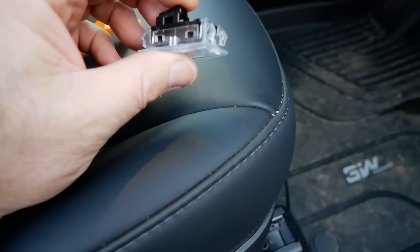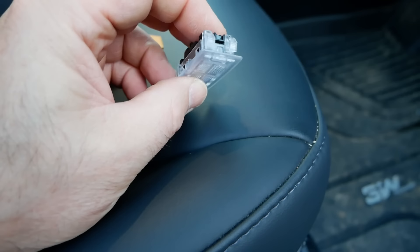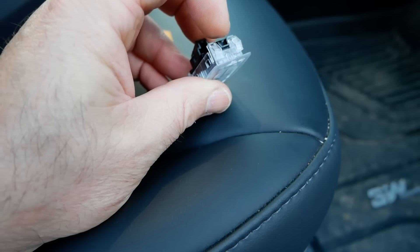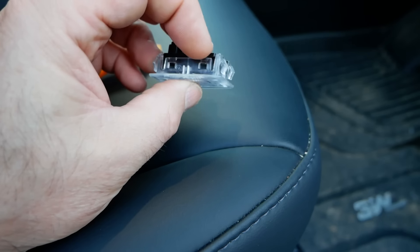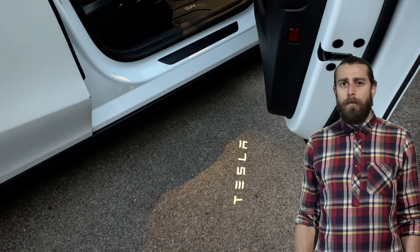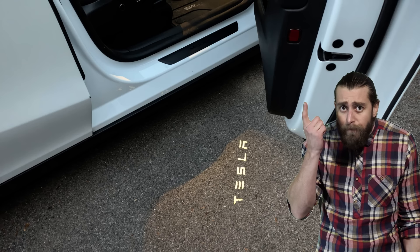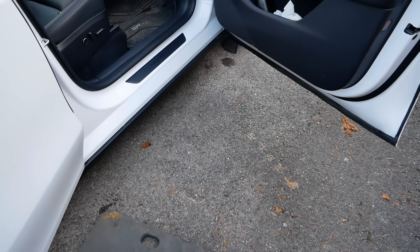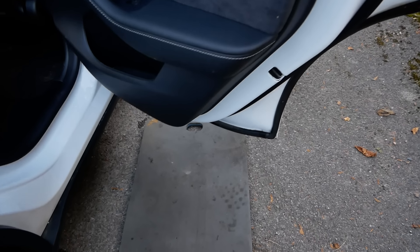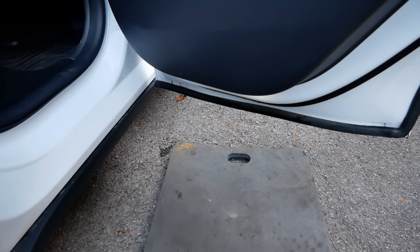When you come to take these out, the clips are in each corner, so when using your screwdriver or plastic tool don't go in the middle — go on the edges to push down those little lugs. At this point I've got the driver's side light fitted the wrong way round — I'll cover that at the end of the video when I realise it myself. It's only about a 10 minute job to do and they are just a bit stiff when they're new. The rear doors on the Model Y have lights as well, but fitting those is another £60.